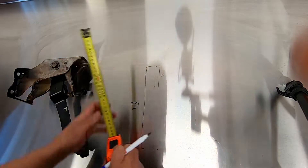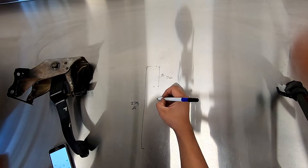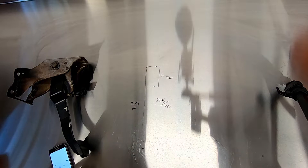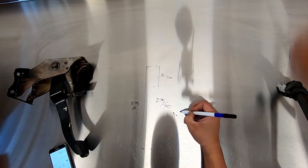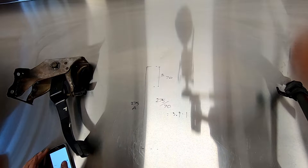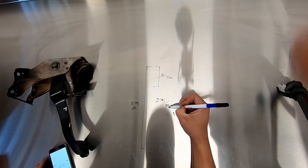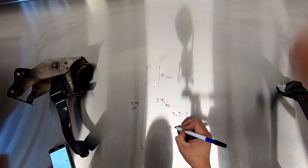Play with your B measurement to get the ratio between 5.1 to 1 and 6.1 to 1, which is basically the standard for any manual brakes. Keep in mind the higher you go up in ratio, the more force you'll exert into the master cylinder, but in turn you'll increase the pedal travel — up to the point where your brake pedal travel can exceed the distance to your floor pan. Also, the higher the ratio the more you'll have to modify the pedal and bodywork to accommodate the master, as increasing the ratio will by definition require a higher mounting position.